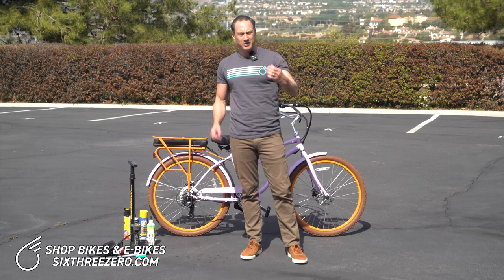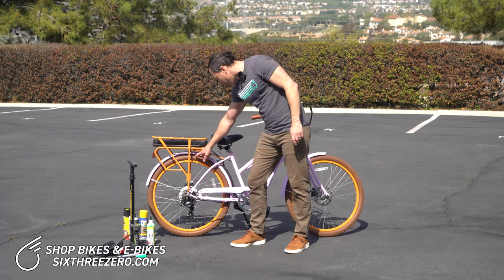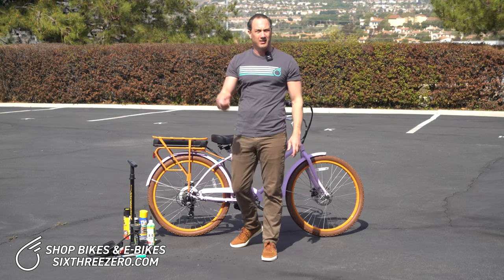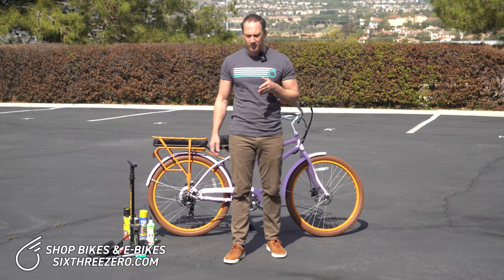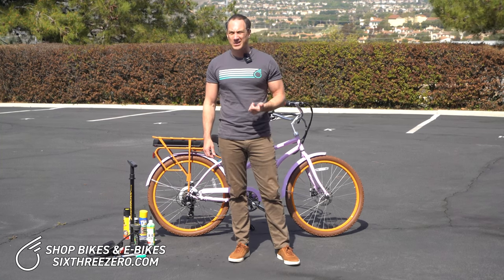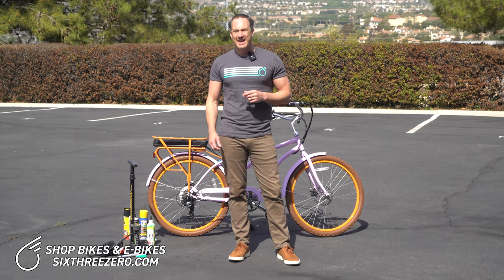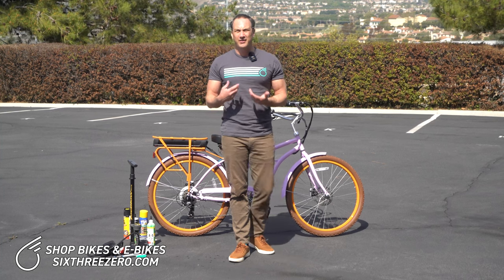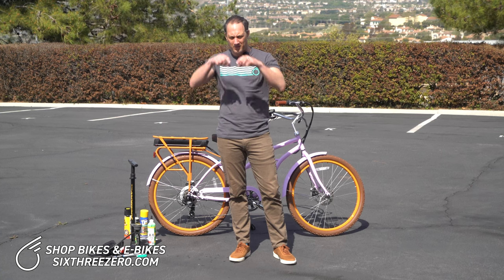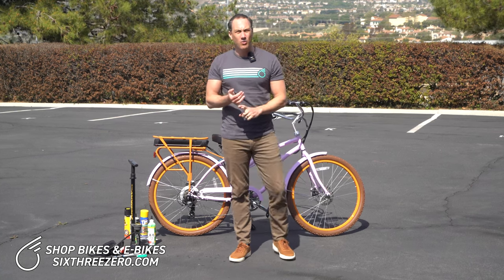You can also get special belts called tire liners, which go around the circumference of the tire in the tread area — which is mostly what contacts the ground, though sometimes you can get a side puncture too. Tire liners are also very excellent. It's a very inexpensive way to protect your tube, and really not a lot can get through these things — they're very, very tough. It's kind of like the belt that you wear on your pants; it just belts the tread area.